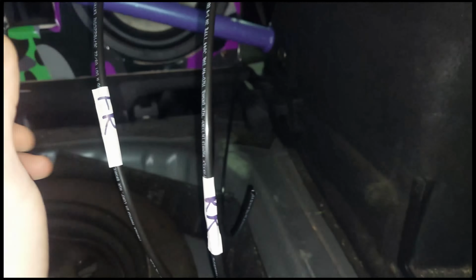If you guys are trying to find line, we have some on our website, or you can go to various suppliers and try to look for DOT rated, preferably made in the USA. I mean, why not, right? But that's the big deal why I like to run the lines on the exterior, just because it's really easy to revert the car back. Take it to any mechanic, it's a lot easier than for them to have to go into your interior and try to go through your panels, clip the panels again, break more clips, and then you take it to the dealer and the dealer's like, ah, look at all your clips are broken.